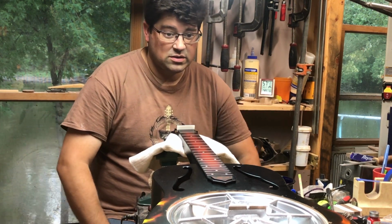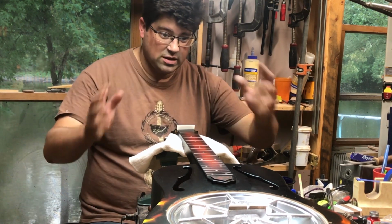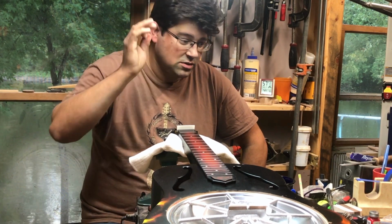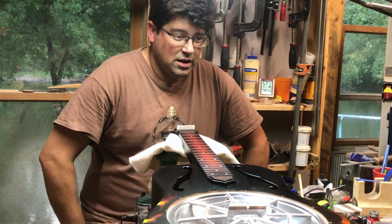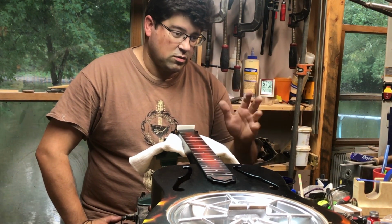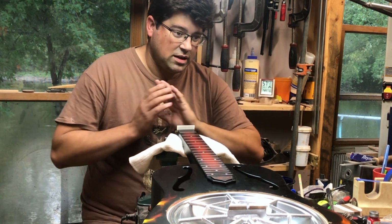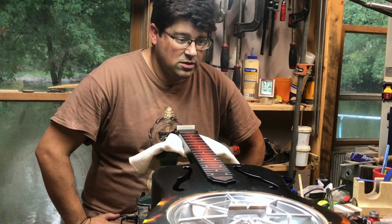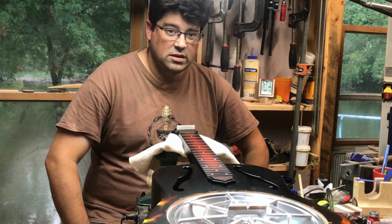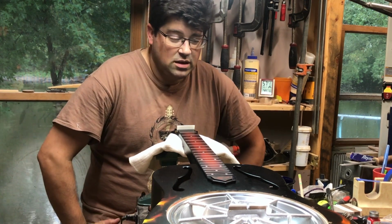When I was painting cars, it was all the restoration and putting these things together, customizing them, ground effects on the cars, and doing fancy paint jobs on them. I remember one particular one, the guy couldn't afford for me to color sand, what we called in the old lacquer days, color sanding the car down, taking the texture out and making it flat. He couldn't afford for me to do that and then buff it to a shine. So we just got as clean a finish as we could, smooth and slick. And he took it to the shows and he did okay. He won some awards.